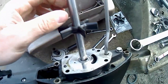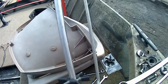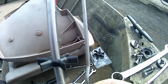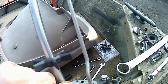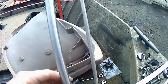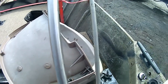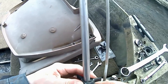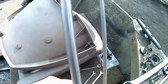I've got the impeller on the shaft. It doesn't matter — you can't put it on upside down since we're putting a brand new one on. You're going to want to take the key and put it back in the groove. There's a hole on the impeller; you line the key up with it and it should just slide right over the top when you get it lined up.